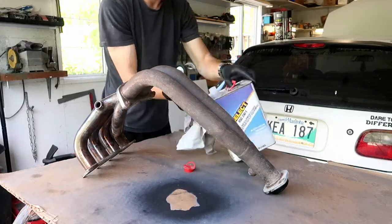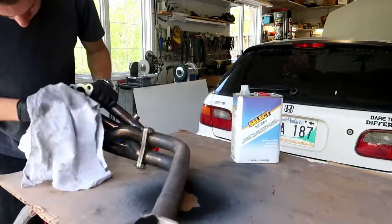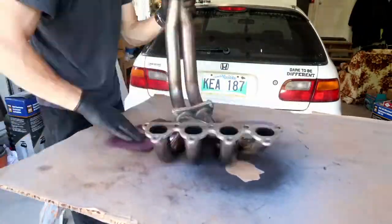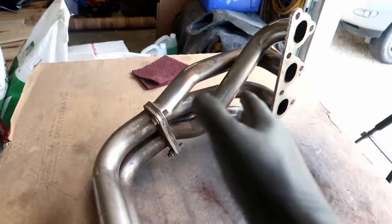I'm not going to paint it lying down — so many people do that and I don't know why. Hang it up so you can get all the way around it. The time-lapse was set for about 30 minutes and it took a little over 30 minutes to do this whole thing nicely. I started off with just a scratch pad and it kind of worked but wasn't great. So I got one of these scuff pads — it's like sandpaper but in pad form. This isn't something you'd pick up at Canadian Tire. This is more of a professional auto body thing. I'd recommend going to somewhere like Bestman or Rondex, a professional body shop supply company — everywhere has them because everywhere has body shops — and that worked really well.